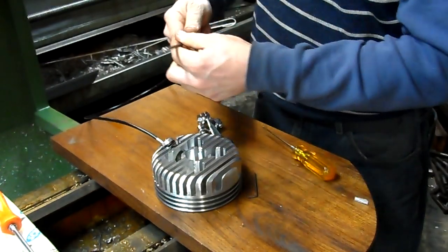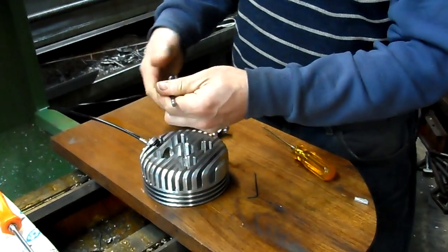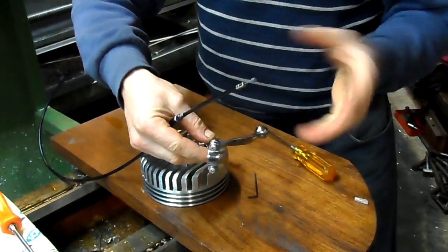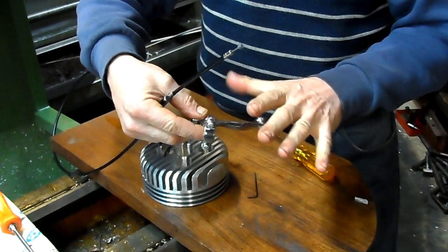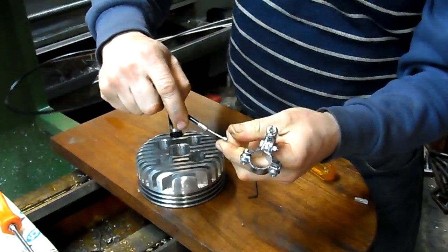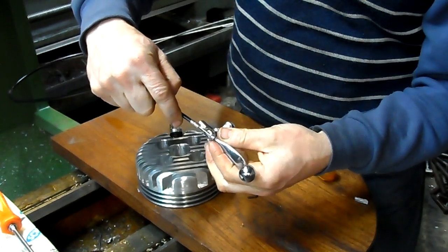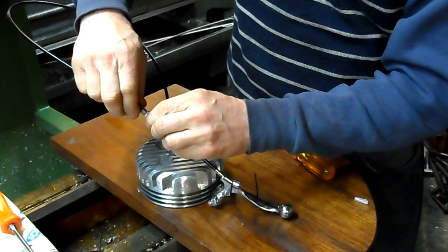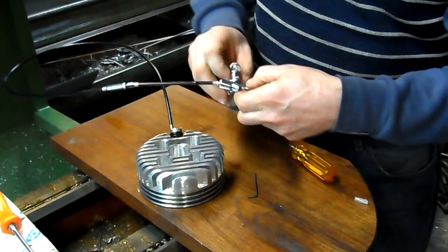Now you can put on the handle — you'd mount the handle on your bike. Then you'd put this on your engine and route your cable. Then you'd come around to where you have it attached to your handlebar. I have it as a thumb control on my left hand — that's how I prefer to do it. So the clutch is with your fingers and compression release with your thumb on the left hand. And here's the cable end again — just go like that. And then you can adjust out a little bit with the tensioner.